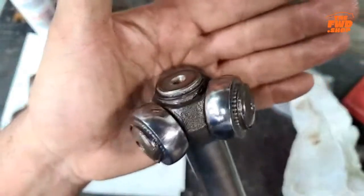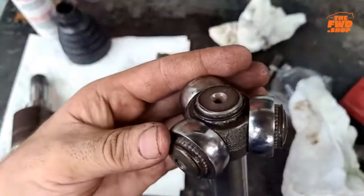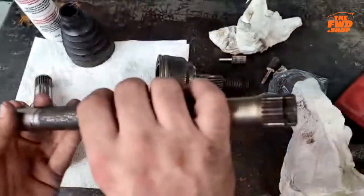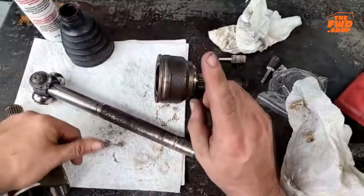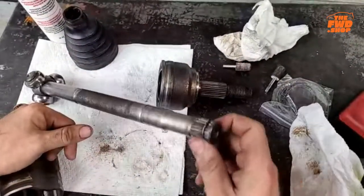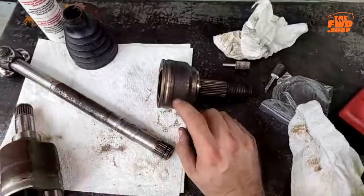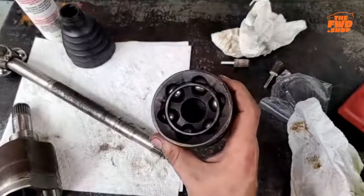This is a Neon Shadow Daytona Caravan. This is a Chrysler axle. This is how Chrysler axles, for the most part, that I've ever found are assembled. I don't think I have ever found an axle that had this style end that did not have some sort of C-clip that you were supposed to just smack off. Don't be afraid to use a plastic dead blow if you're worried about breaking it.